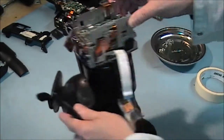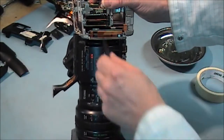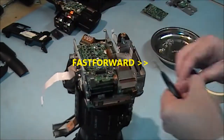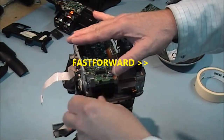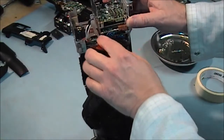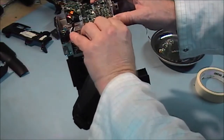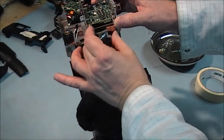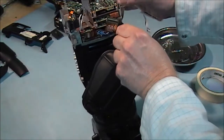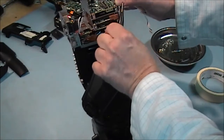I will take out these card readers. There are three screws to the side, and we have two screws on this side, but we have to pull these cables out as well. They have to slot back into their correct slot otherwise it won't work, but normally they fall into place when you are putting them back in — they line up with their connectors.